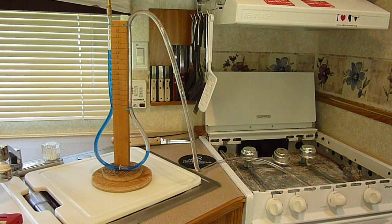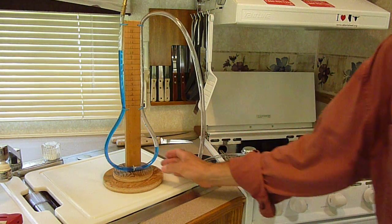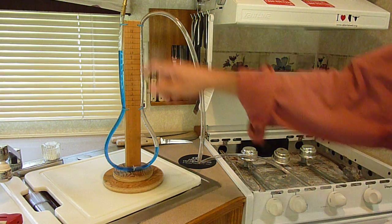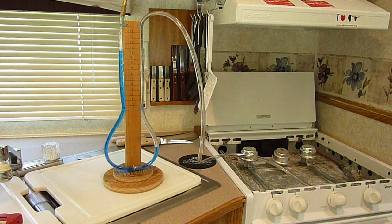Hello and welcome to my RV. This time we're going to check with the manometer to see if there are leaks in the propane system. I have just turned off both tanks, but prior to turning them off I made sure that the regulator was operating properly — at 11 inches of water column the regulator was working just fine.